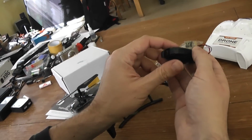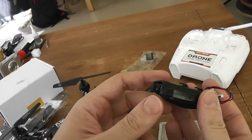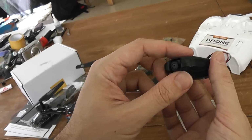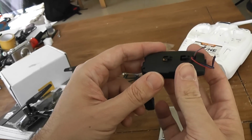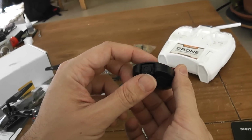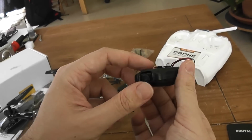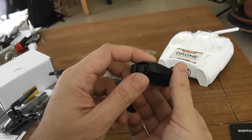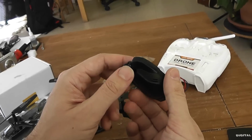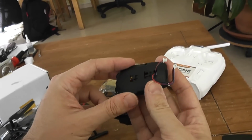One word about this camera module. It's announced to be a 2 megapixel camera module. Wow, in fact, yeah, the video got such resolution, but I think it's interpolated from a VGA resolution, and the photos are in 1440 by 720p resolution. And also you can feel and see a lot of interpolation effect. So for me, it's more of a VGA cam really. The native resolution is more like native VGA.